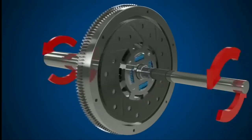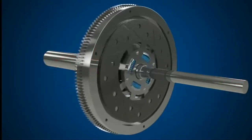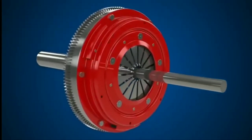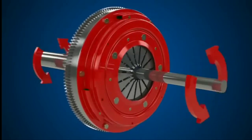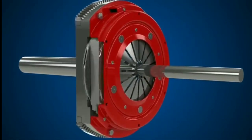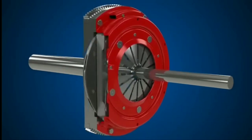To achieve drive, the clutch plate must become clamped to the flywheel. Finally, we have a clutch cover which is bolted to the flywheel. This keeps the clutch plate and flywheel clamped firmly together. Inside the clutch cover, a diaphragm spring provides the clamping force to maintain this contact, allowing drive to pass from the engine, through the gearbox and onto the wheels.